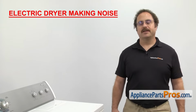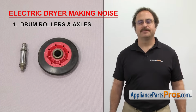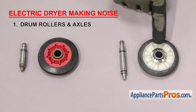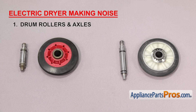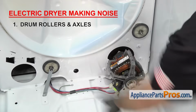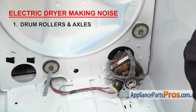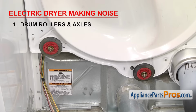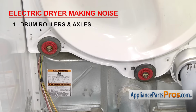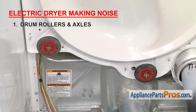The first thing we're going to check are the drum rollers and axles. The drum rollers and axles support the drum as it turns. The rollers have bearings in them that ride on the axles. Depending upon your style, you might have 2 in the back and 2 in the front, or just 2 in the back. If the bearings are starting to fail, you'll hear a squeaking noise. If you let it go too long and the bearings completely fail, it'll sound like there's a pair of tennis shoes tumbling inside the dryer.